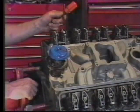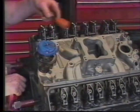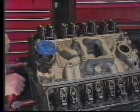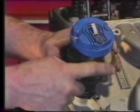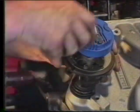Looking up in our spec sheet, we'll also find a diagram showing proper firing order and proper positioning of the distributor for number 1 firing. Let's assume that the front of our block is at a 12 o'clock position and the back of the block being at 6 o'clock. We looked up in our specification book. Our distributor contact should be facing approximately 1 o'clock to be properly phased with a crankshaft.